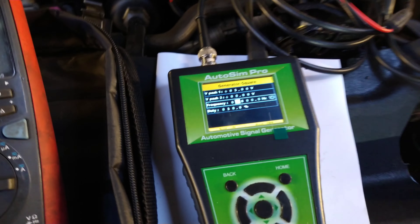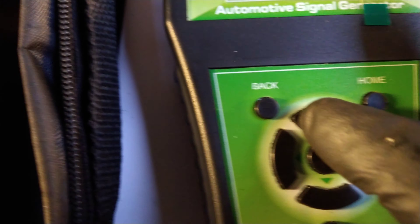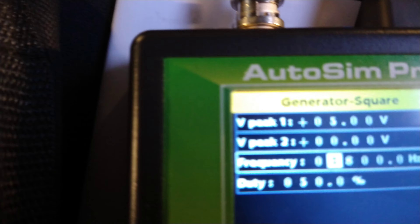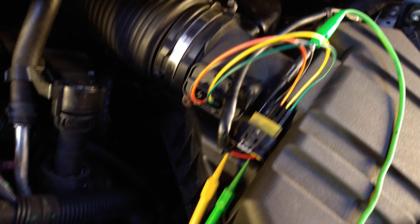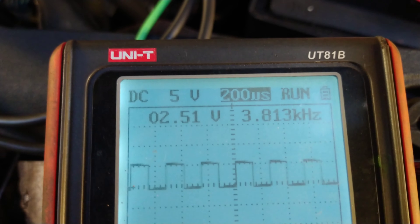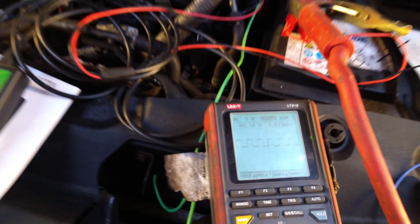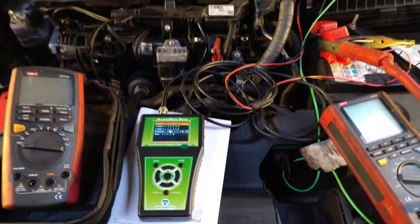I thought I'd pass that on — I'm just experimenting. If somebody's had trouble getting this to do a frequency, I'll change that again. So it's 38 now — see there? We've had a response, it's gone up. So we know this is working. The main thing from this video is you need these little pins to bridge all the other wires out. That's the actual output on the scope. Hopefully that helps somebody with connecting this digital mass air flow sensor test. Thanks for watching.